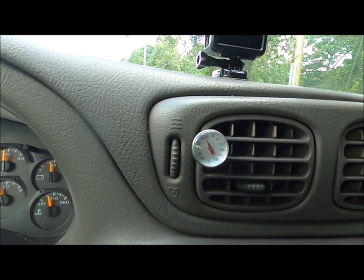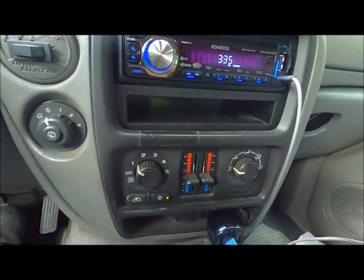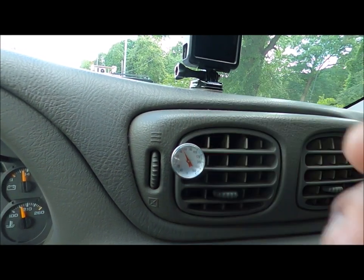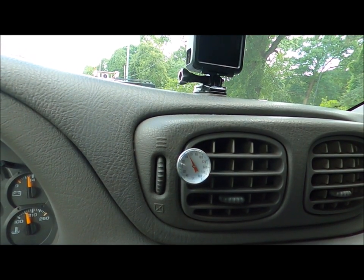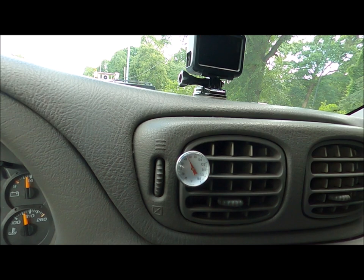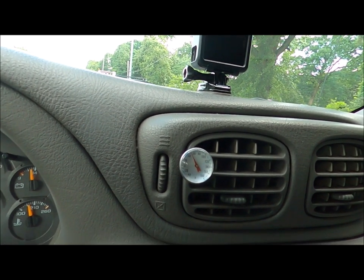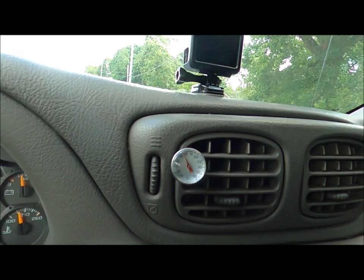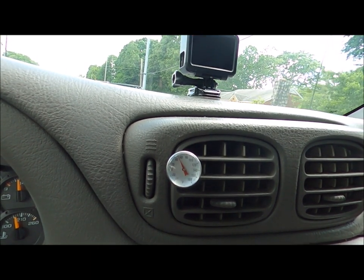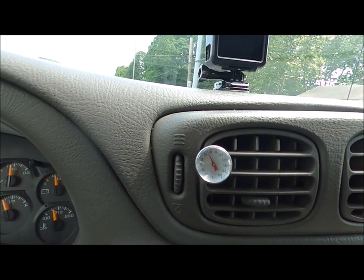That's amazing — I went from about 39 degrees to 50 degrees by going halfway on the heat blend, and it's still cool. I've never vacuumed my system — never. They also claim that if you get air in the system you have to throw away your filter dryer because it won't work right. Don't believe every single thing they say.